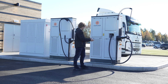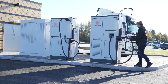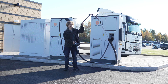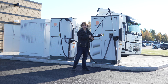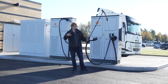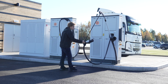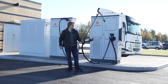What is insane is this cable — it's rated for 1500 amps. Let's try this one. You have to get it out of the holster because it's so enormous. But even this cable is quite light, and I like the cable management. This is so thick — it needs to hold the entire connector up. What I noticed is that this cable is way shorter, and that's of course due to the high amperage rating. But most electric trucks have a standardized position of the charge port where the driver is, so you just pull in and you can charge. I could probably plug in the MCS connector with one hand, which is quite impressive.